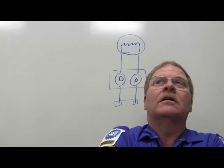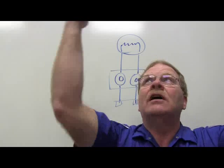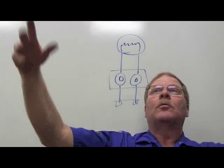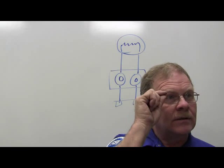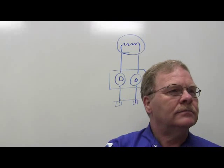Okay, I'm going to look around, and like if it's courtesy lights, you know, and you got the ones on your visor, and you got this one up here, and you got the ones in your doors, and all them lights that come on. All right, I'm going to look at all them lights, and I'm going to open up the visors and all that kind of stuff. And one of those lights, if there's a short leading to one of them, one of those lights is not going to come on. The rest of them will.